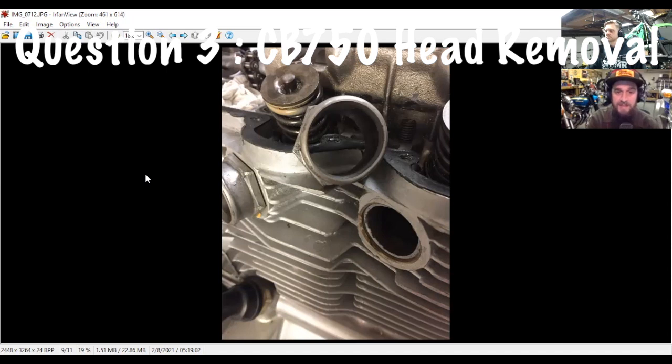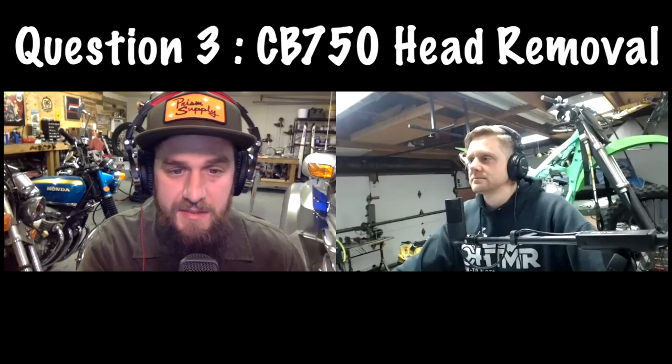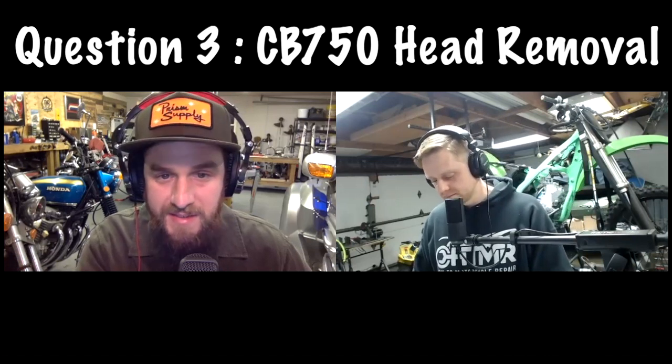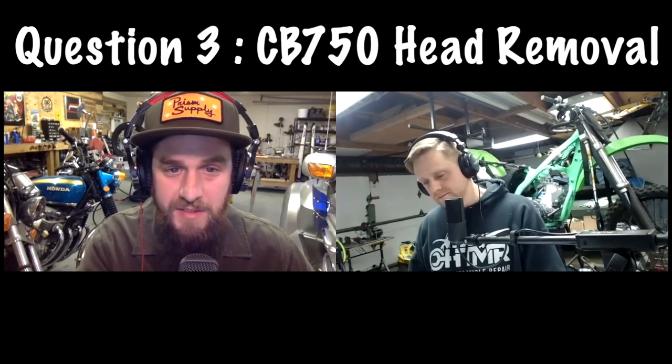In fact, it's now lifting the cylinder as well as the head. The only thing I can think of to try is to remove the head and cylinder together, and once removed, try using a substantial wooden drift up the bore of the cylinder. However, this doesn't really appeal to me, as I'd prefer to remove the head first and then the cylinder and barrels. Any suggestions? More beer for advice will be forthcoming. Cheers, guys.